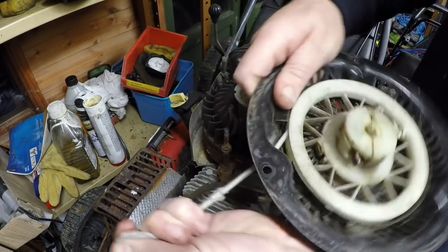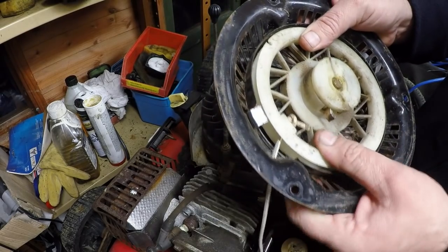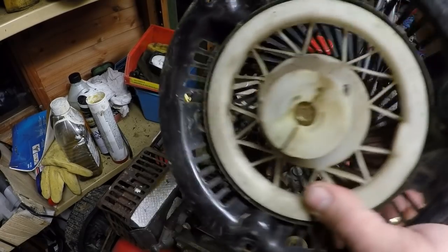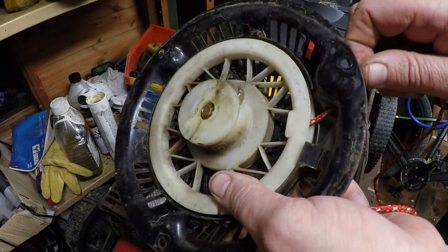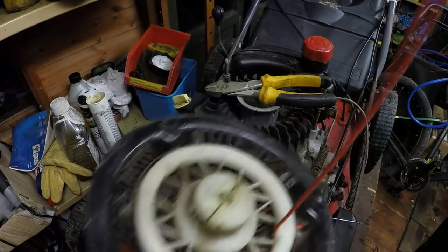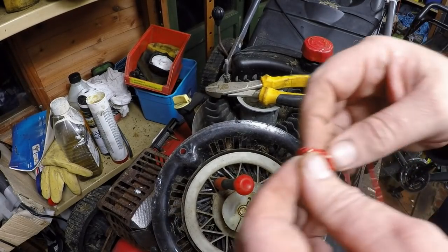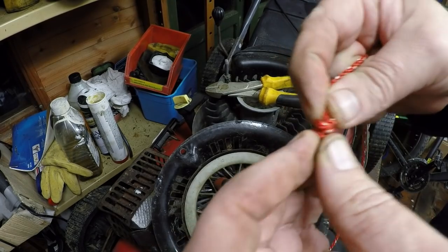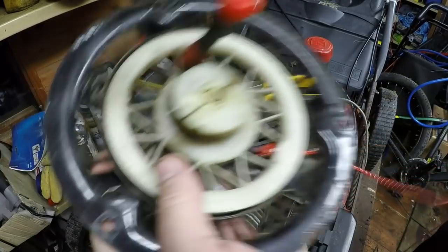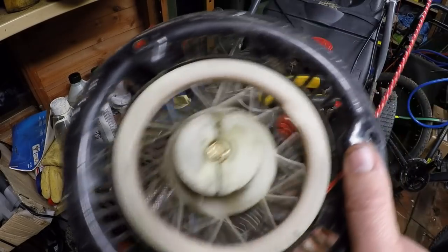So it's all got tension on it, so all I'm going to do is literally pull this as hard around as I can go, then put something long and thin through there just to hold the pull cord where it needs to be so I can retrieve the rope. I'll get a hold of the end of it, thread it through the hole. Pull that through, put the screwdriver back in just to hold it. Tie that in a couple of good knots. Pull the knot back, remove the screwdriver, let the pull cord retract all the way. That's taken up pretty much all of that seven and a half feet of cord, which is just about where you want it.